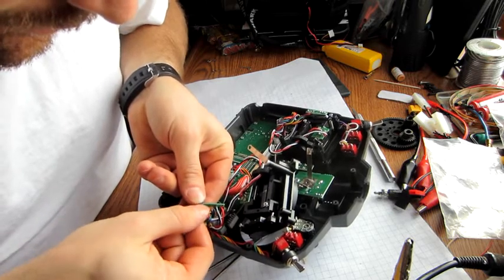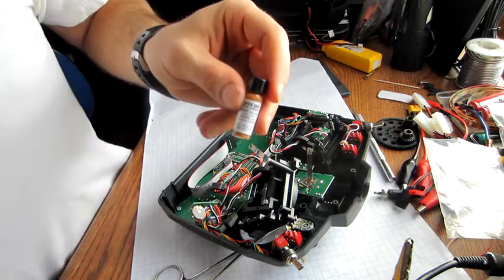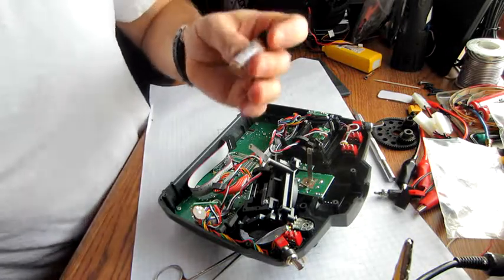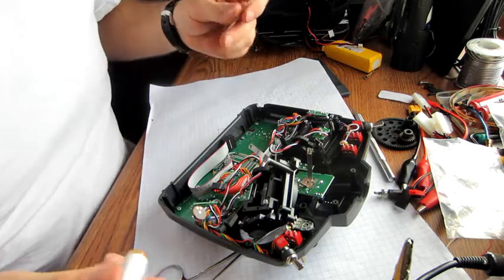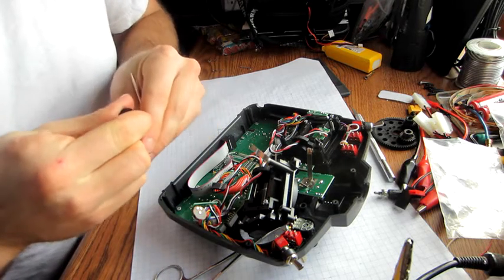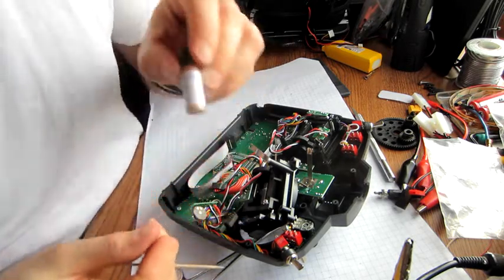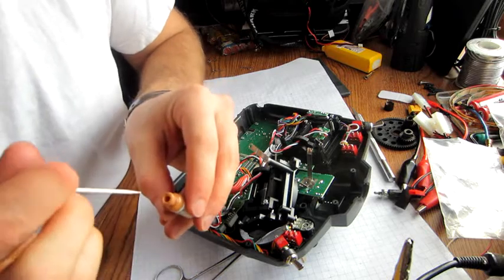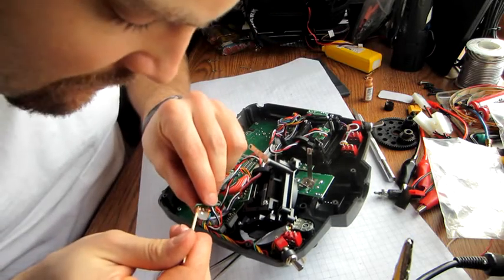What you're going to need is a window defogger repair kit — it comes with a material that is conductive, basically conductive paint. You can get conductive pens online; they're silver or nickel, but they're twenty to sixty dollars depending on quality. Make sure you shake this stuff up because it's got a conductive solid with a solvent in it — if you don't shake it up, all you're going to get is the solvent. Use a toothpick; you've got to be pretty quick because it dries fast.